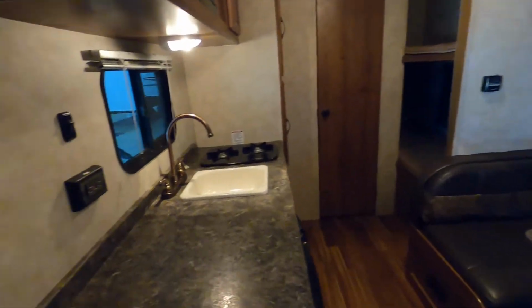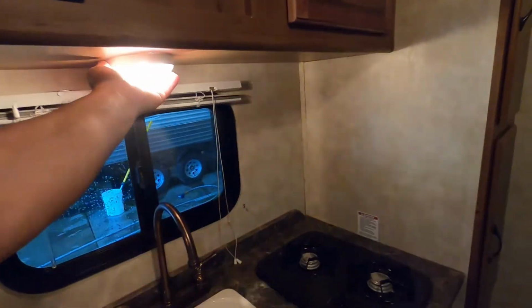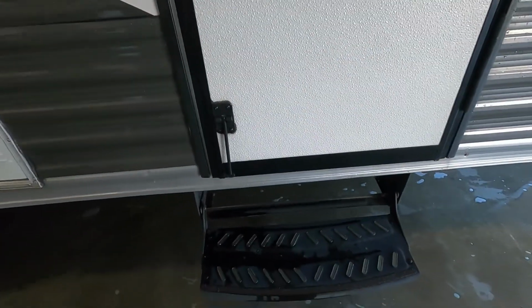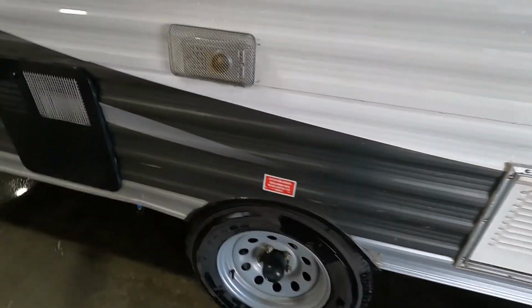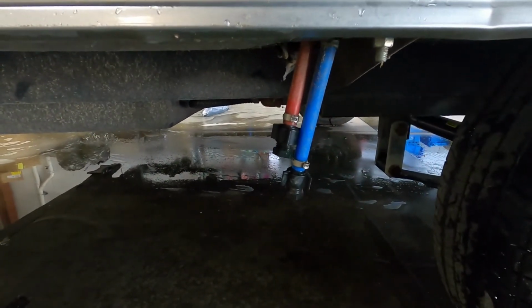Let's act like we're going to leave the campsite. To shut off these main lights, and see that I have lots of individual lights. Heard the furnace just shut off. Once we've got all of our lights off, we exit the unit, bring up our door. Unhook your cable and water. Once your water is unhooked, you go ahead and pull these two low point drains.